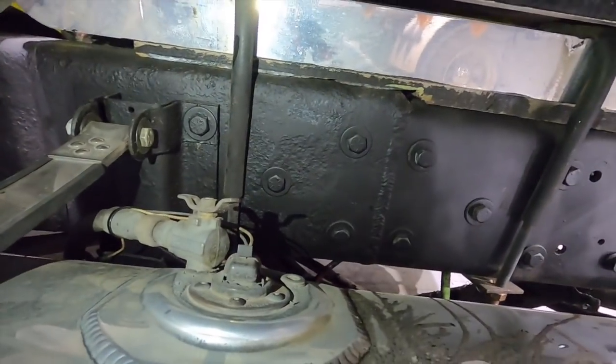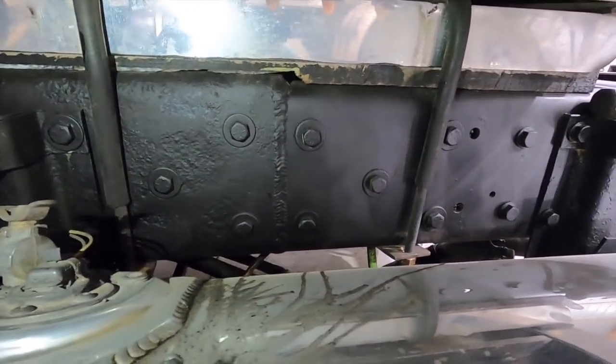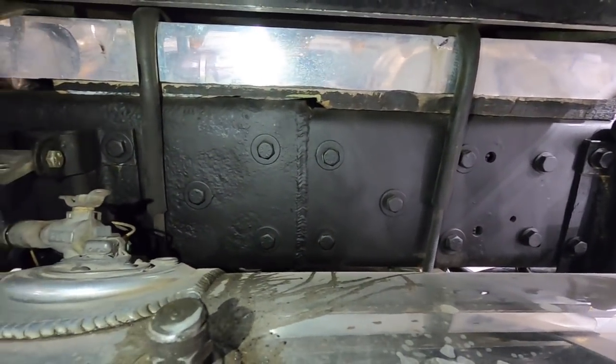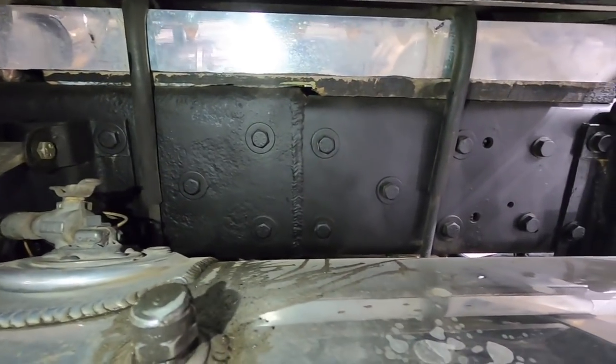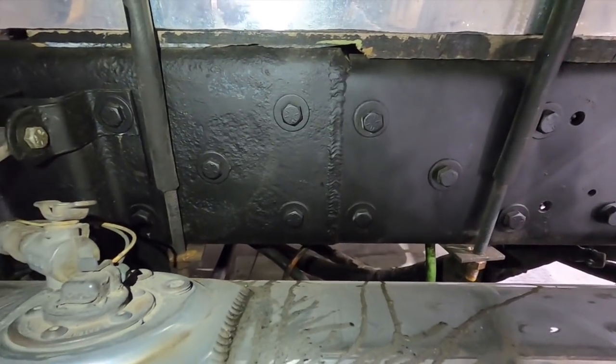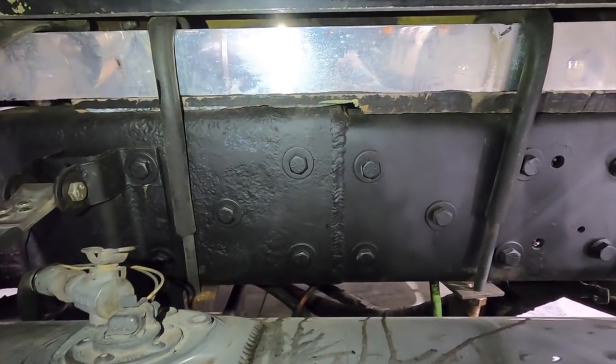The frames were different in height by 1/2 inch. So that means we're gonna have a step from one old section. The Kenworth was a little bit taller. The International was 1/2 inch lower. So we made them flush along the bottom for strength, and the step is up top.